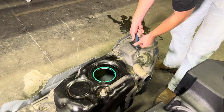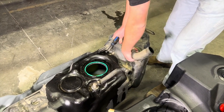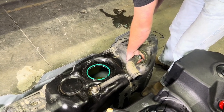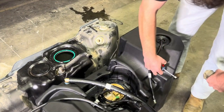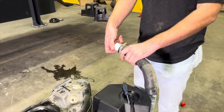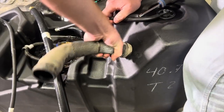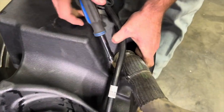We can now transfer over our hose clamps and filler neck tube — remember how it was facing and install it the same way on the S&B tank. With the filler neck removed, go ahead and press in the check valve, making sure the flow arrow is pointing towards the tank. The white line is going to face directly up — push it all the way on and make sure it's snug. It doesn't need to be crazy tight so that it collapses the tank, but if it's loose it'll leak as well.